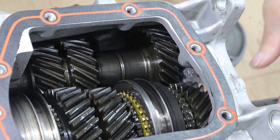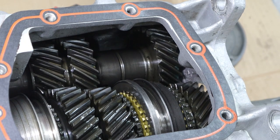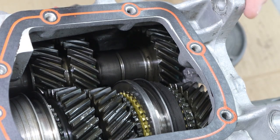I really think it's this 3-4 slop right here - what they call the slider slop. The plan is I bought a shim set to shim the input shaft, and I got that right here, and I bought a new nut and a new bearing. Let's go ahead and get that in and see if that remedies the problem.